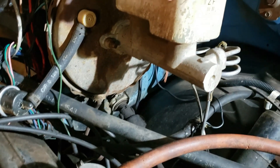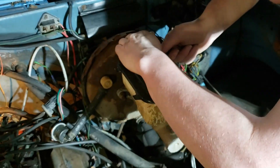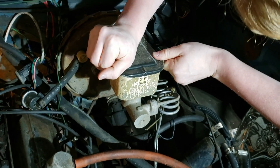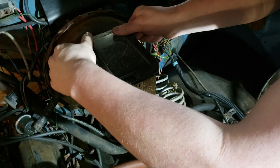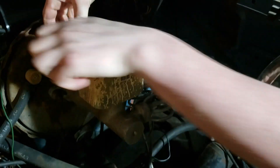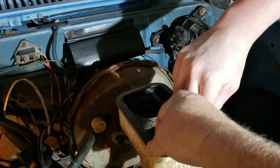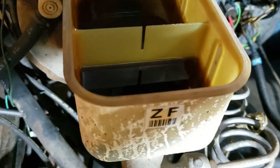It was only going in reverse when we bought it. Let's see what's in the master cylinder — give me an assist on it, should just pop off. Sometimes the lid has a bellows on it that sucks down when it gets low on fluid to keep air out. Those little reservoirs look like they are extended out, but there's fluid in it and the brakes do work when you push them.